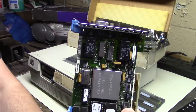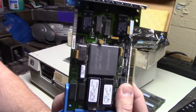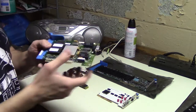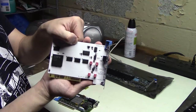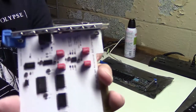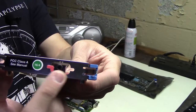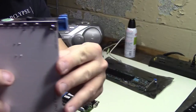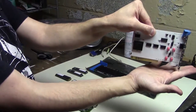The only problem is this bracket is riveted on, so I had to drill it out and hopefully attach it to the sound card with screws and nuts. I managed to drill out the rivets on the token ring card to take the bracket and put it on the sound card. I didn't have the correct nuts, so I used the screws from the token ring port with some nuts that matched. While not pretty, it is at least attached to the card and should fit in the computer properly.